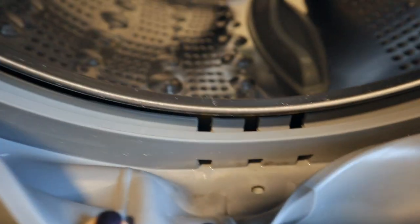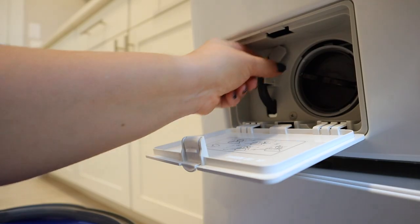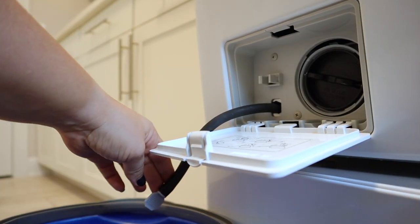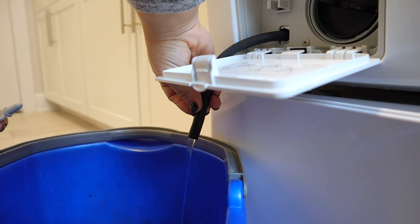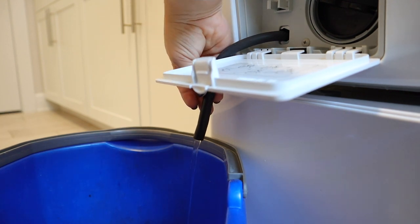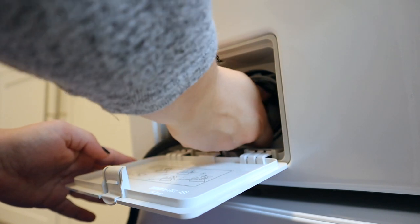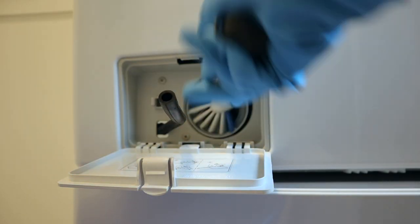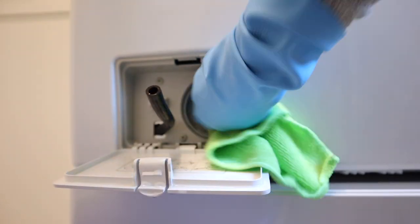At the end, I was really impressed with how much of that stuff I got out. Leave a comment down below if you actually knew what this area was for, because I did not. This is a part of your washing machine that you should be emptying out pretty regularly. There's a hose here that has extra water, so you definitely want to drain this. I haven't done it in a while, which is why there's so much in mine. And then there's a little filter as well — you'll go ahead and take that out. This is where some extra things can get stuck, like coins or other items. Mine mostly just had gunk on it, and inside also had gunk, so I gave the inside a nice scrub and made sure to wash the actual filter.